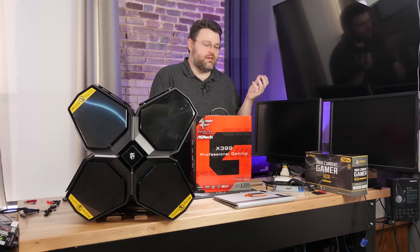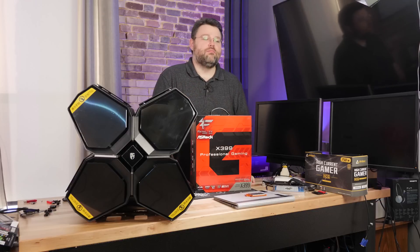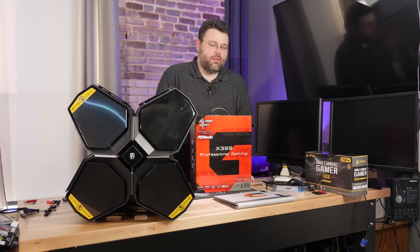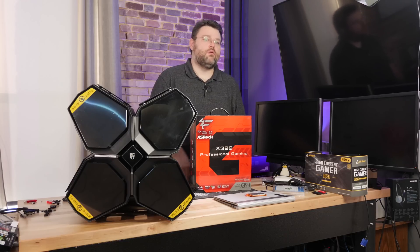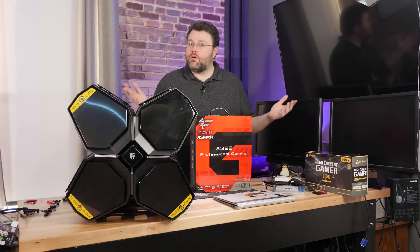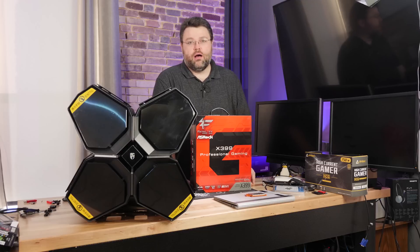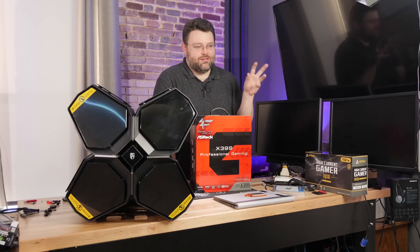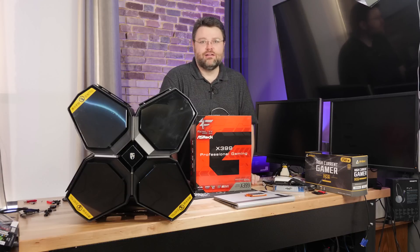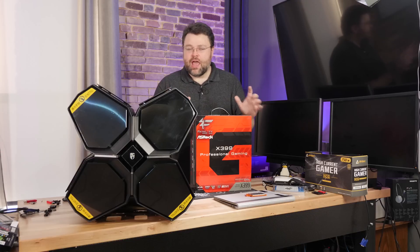This is exactly the kind of thing that Linus Torvalds loses his mind over. I think we can probably fix it in BIOS by having SEV disabled by default, since it shouldn't be a thing on Threadripper anyway - although some people did report getting encrypted memory working with older versions of AGESA on Threadripper. If you know about that or have any experience to share, come to the Level1 forums and clue me in, because I could use more help in this vastly complicated array of insanity.